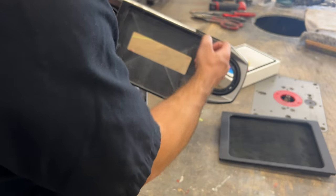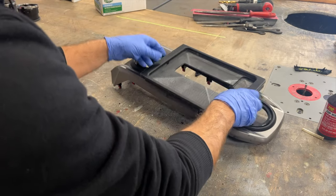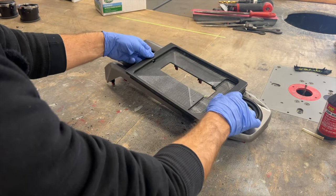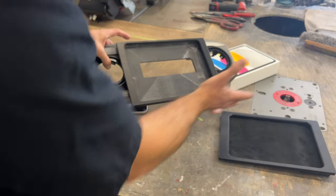This one I trimmed down the bezel super thin. I cut a DIN-size hole for the customer's aftermarket DIN radio and tacked the kit into place. Then this will get epoxy, fiberglass, body filler — body worked smooth.